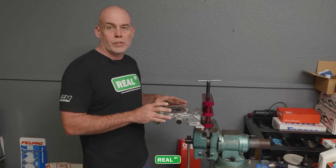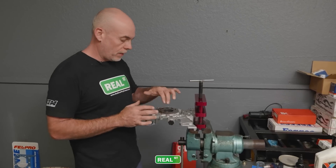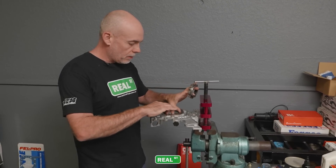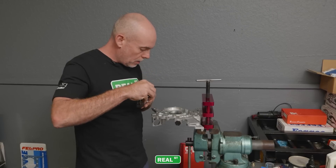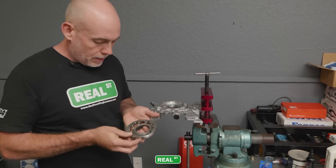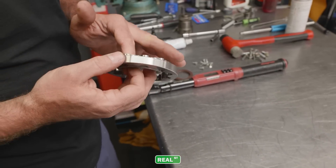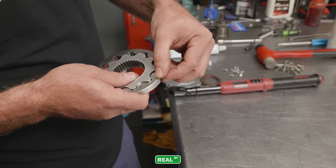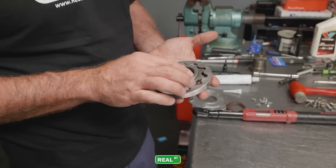When I started working on 2JZ engines, I would take the pumps apart and they were all fairly covered in grease — the rotors were fairly lubricated. Nowadays it seems like the pump rotors come fairly dry. So if you take the pump apart and look in the housing or at the gears, there's not a lot of lubrication present. You can get a little tiny bit of flash rusting here — just rub that off with your finger. But you don't want to dry-start the pump because it could score the housing.